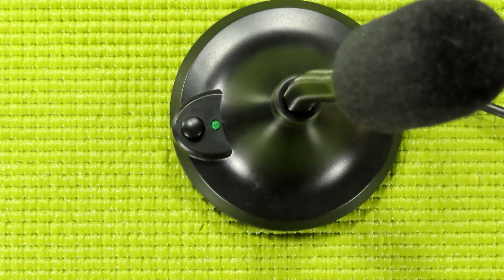When you hit that button, it interrupts the circuit and actually makes your computer think that you've unplugged the microphone. And while technically you could use that as a mute function, most software is not going to be happy with you if you do that. I know programs like Audacity, Streamlabs, Voicemeeter, and heck, probably even Discord tend to get a little on the crashy side if you just spontaneously unplug the audio source that they're monitoring.